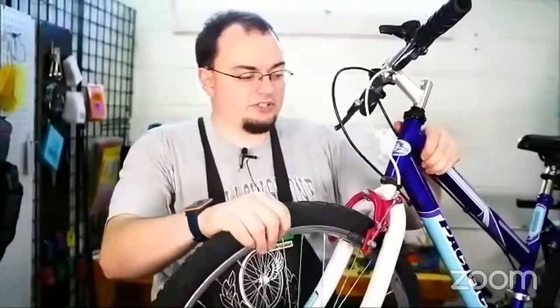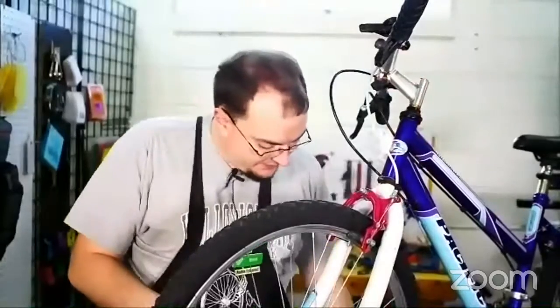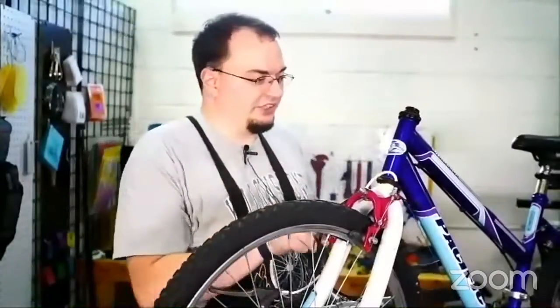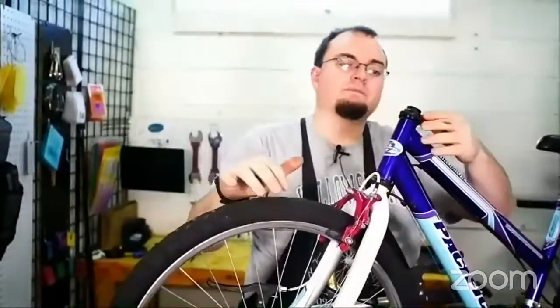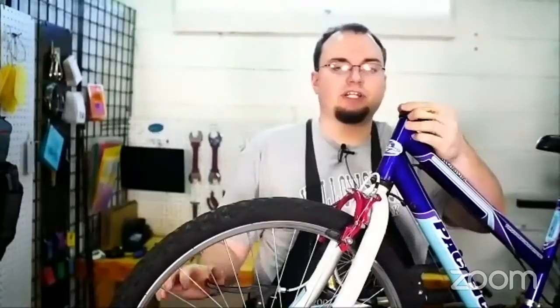First step — let's say you have your bike and the front handlebars are just loose and shaking around, like it feels like your bike is coming apart. This is how you'd fix that. First, I'm going to loosen the bolt in the top of the stem. The stem is what holds the handlebars. I'm going to loosen that bolt and let it dangle there — the cables will hold it on.